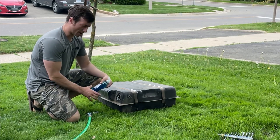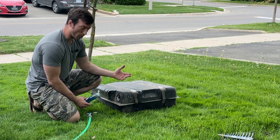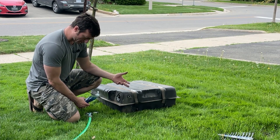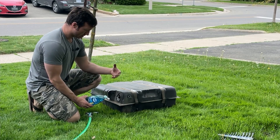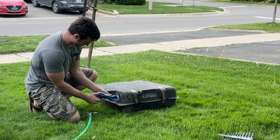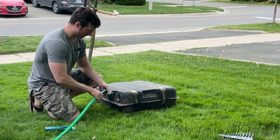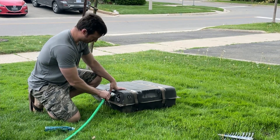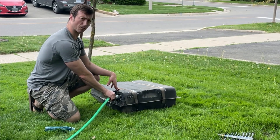This tank's been empty for a long time — it's been emptied since I dropped it. It's been airing out well over a couple months now, but it still has a bit of that gasoline smell to it. So what I'm going to do is give it a good rinse using some Dawn dish soap, rinse it out, and then dry it. I don't think it's the metal so much holding onto the smell, but it might be the lamination that's flaked off keeping that gas smell in there. We'll give it a good rinse and see how it goes.